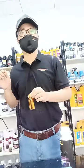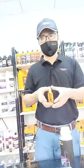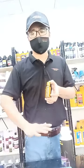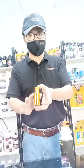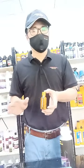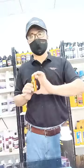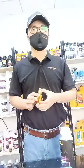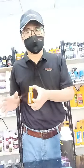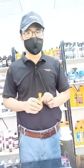Normal paint is from 40 to 70 micrometer thickness, I mean clear paint. And this one increases it by 30 micrometers. After we clean everything and apply this one, most important, do not wash the car within 7 days, and do not touch water, I mean rain, within 3 days. During this period, this is 100% yield, I can guarantee you 3 years of the coating working on the paint.